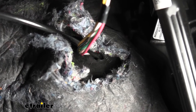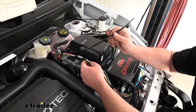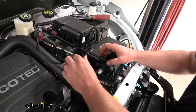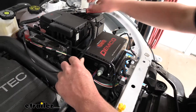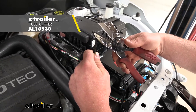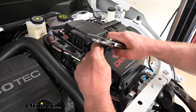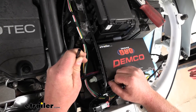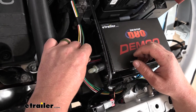In the engine compartment, here's where our wiring and nylon air tube come up — routed alongside each other towards our main operating unit. While we're here we can get the other end of the airline tube plugged in. For the tube end, use a tool like a utility knife or tubing cutter — not regular snips, as those can pinch it and potentially create a leak. You want the cut nice and flat, straight, no burrs. Then it just plugs right in to the operating unit the same way as the actuator cylinder.